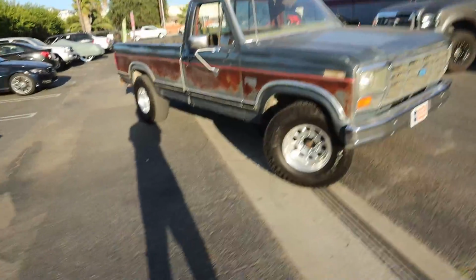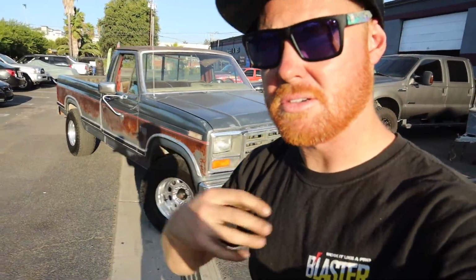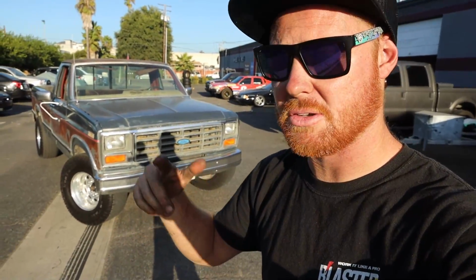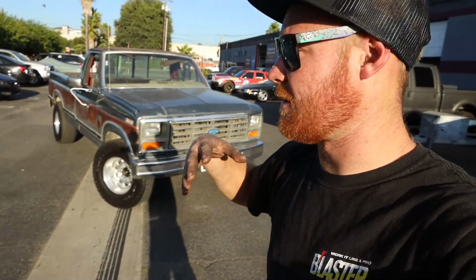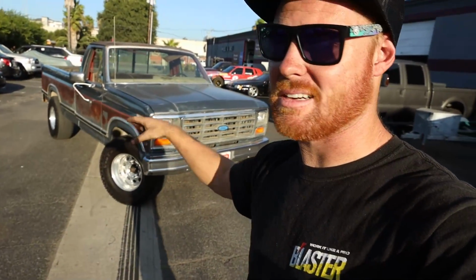So for those guys that were wondering, underneath this thing, I didn't really go over it too crazy, but like I said in the beginning, we have their 2.5-inch full builder's kit, so it has everything you'll need from straights to U-bends to 90s to 45s. All that played a huge part in making it so easy to get it all the way from the front to the back and around the gas tank and the transmission and all of that stuff. I used their stainless 2.5-inch X-pipe. This entire system is 2.5.